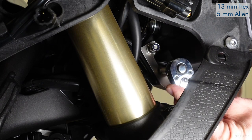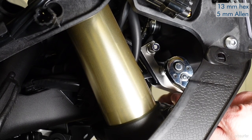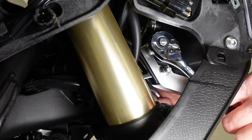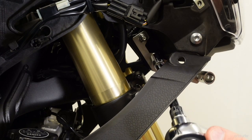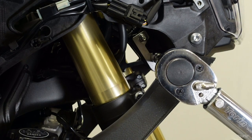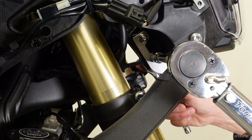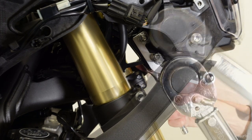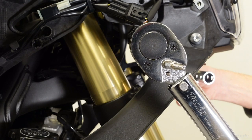The two bolts underneath the headlight are supposed to be torqued to 8 Newton meters or 6 foot-pounds, because they're stainless steel according to Turatec's table. If they were regular 8.8 grade steel, the torque would have been 23 Newton meters or 17 foot-pounds. These numbers don't really correlate with the strength differences between bolt types in any table I've looked at, which is a little weird. Torque to the first click.